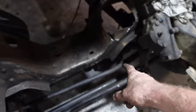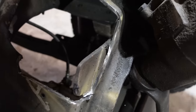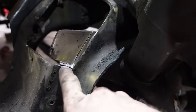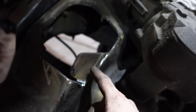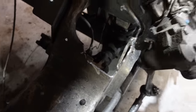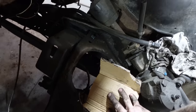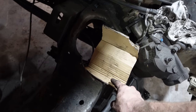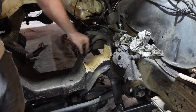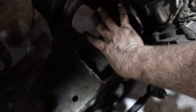Because we had the bracket from the panhard bar welded underneath, we had to raise the crossmember up a little bit. This is the maximum amount — our alternator sits right here, but that still gives us a little bit of meat to weld the panhard bar bracket to the crossmember securely. I'll trim this off, then get my CAD — cardboard accurately drawn — and put that in there. We'll tap it with a hammer to get the outside profile, then cut it out of steel, bend it, and weld it out.